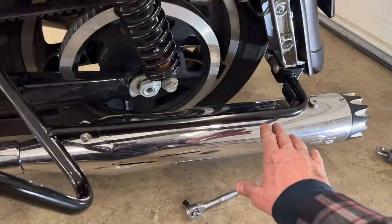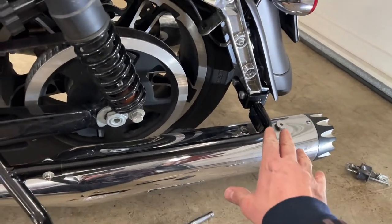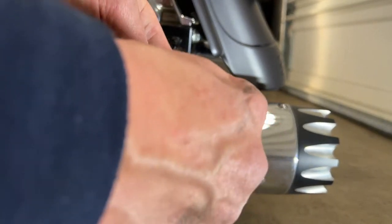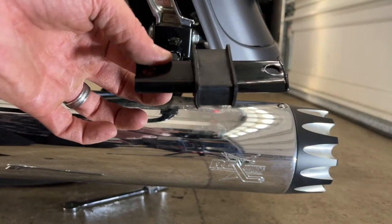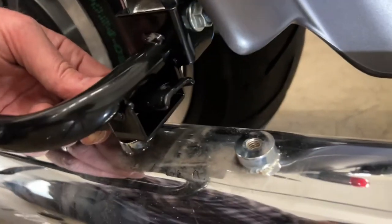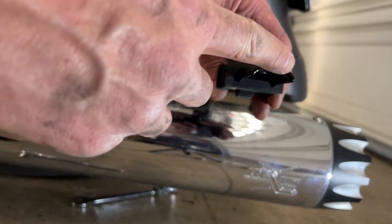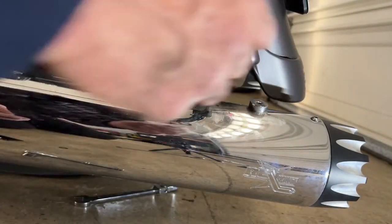Now I'm going to get a clean rag and wipe off the exhaust a little bit. These are actually pretty nice — came with the bike, looks like a nice four-inch exhaust and they sound good. So right here is your main bracket. What we need to do is take this piece, slide it through the rubber seal. You can always use a little bit of grease. You put it through like that, then slide it into the actual brace right here. Slide it all the way through, get it mounted — when you put it through, you want that facing up, just get it through this gasket right here and bolt it back down.